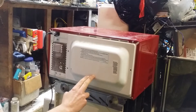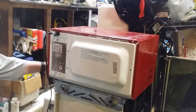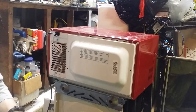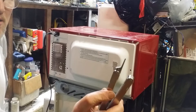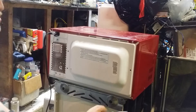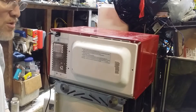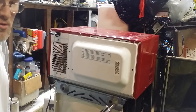The first thing we have to do on the donor microwave is to take the shell off. Most microwaves just have screws along the backside that you can remove; some of them have screws on the side like this one. Once in a while, newer microwaves will have a dot-head Torx screw that you can't remove with a regular Phillips screwdriver. In that case, you can use a small-headed screwdriver inside to catch the screw head between the dot and the outside edge, or if the dot breaks off, use a pair of pliers to catch the side of the screw, get it loose, and then use a small screwdriver to remove it.